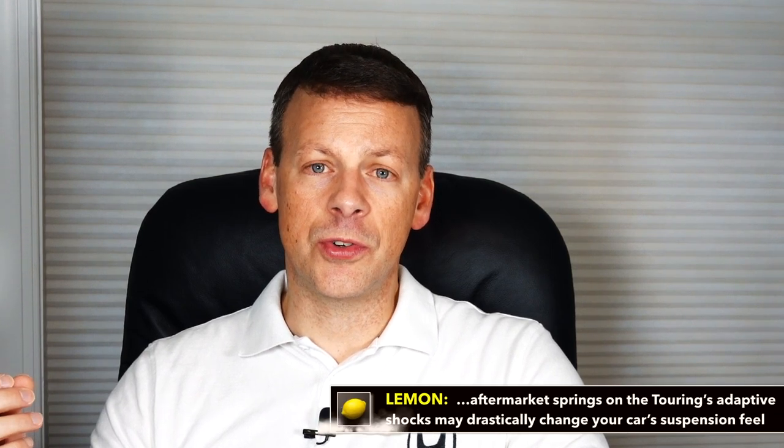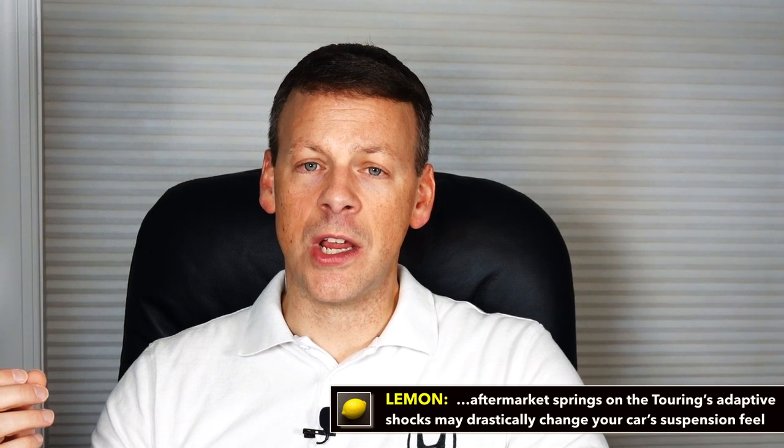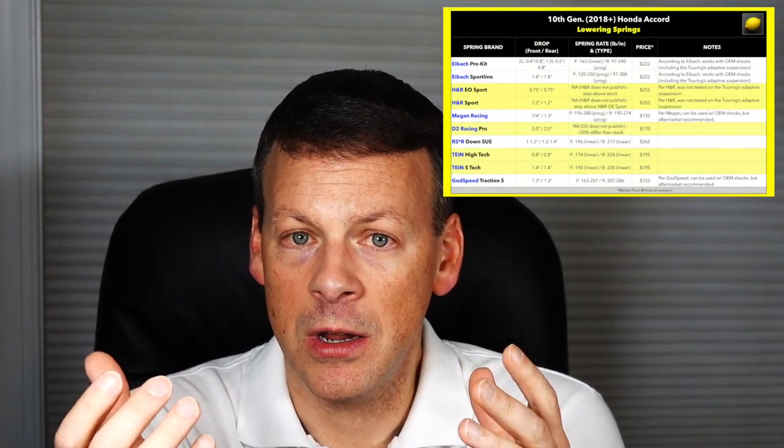Your adaptive shocks are different than the shocks on the other trim levels, and it will change the ride characteristics of your car. So if you think your car rides really nice today, from a dampening perspective, you might want to really consider or reconsider lowering your car on springs. Or maybe you have a less aggressive drop and or a less aggressive spring rate with your lowering. So I don't want you to get one of these springs not knowing that it really could have more of an impact on you owners of the Touring model than it would on the other trim levels. So keep that in mind.